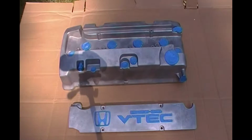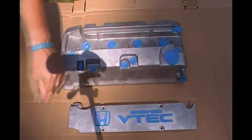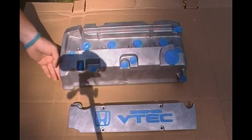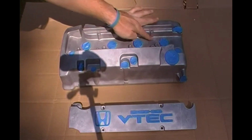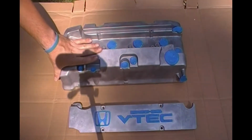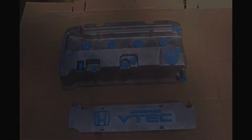For a while there I ended up buying a new paint stripper. It was an aircraft paint remover. The easiest thing I did was actually use a razor blade to get the big surfaces. In smaller spots I did use my wire brush. Now I'm not going to lie, once I hit a certain spot I just could not get the paint out of some of these little crevices. I did take it to work and I used a sandblaster. If you have access to a sandblaster, it is going to make getting all these spots easier.